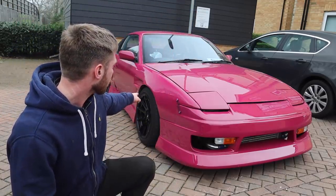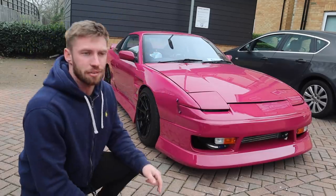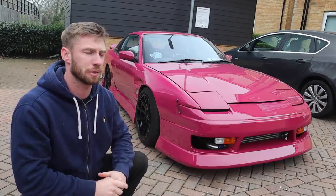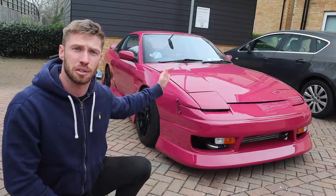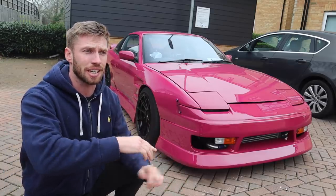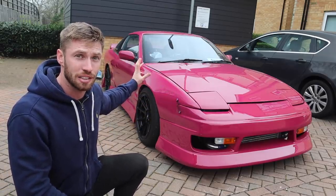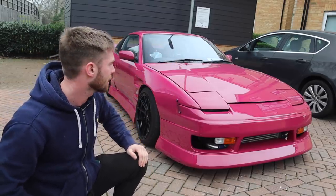I think one of those reasons is because our wiring loom is in here, and every time I took the wheel off there's a few exposed wires and that wiring loom is not in a good place. We need to relocate it. Some people on the S13 page have done it and it looks pretty easy. Apparently people have had the issue where it's been running like shit because it's rubbed through the knock sensor wiring. It did it a few weeks ago and kind of fixed itself after 10 minutes, so I just forgot about it. But it did it again the other day when I idled it. We're gonna look at the wiring loom and fix any wires that are knackered.